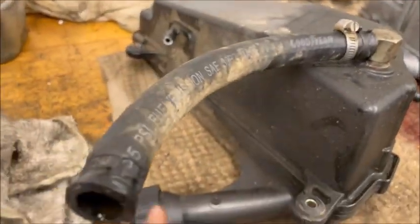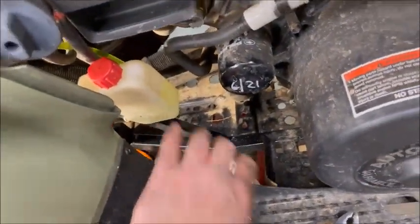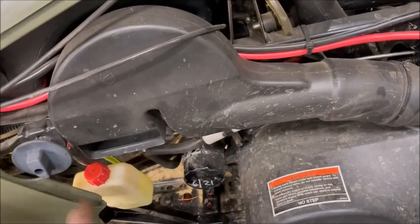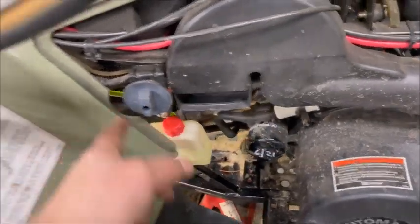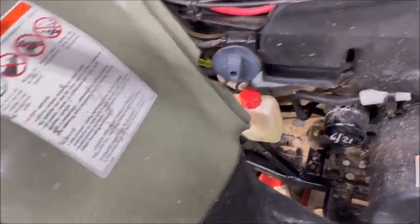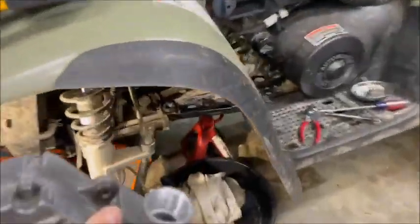I'm going to dry fit the tank. The other major difference is the oil fill neck — on the plastic tank it's down here, which is convenient because it comes out right here for filling. On the aluminum tank the neck is way up higher, so I'll have to use a funnel with a tube that snakes in, maybe from the side. To check the oil you'll have to do it from the bottom side.